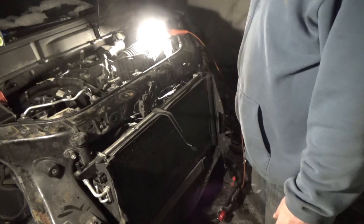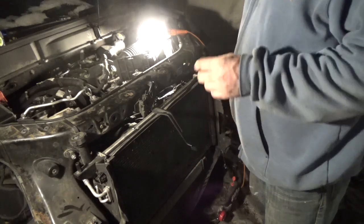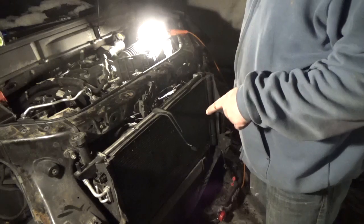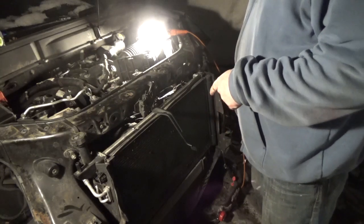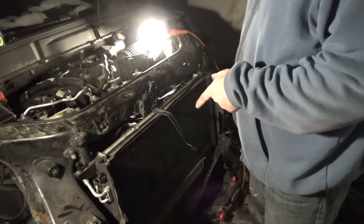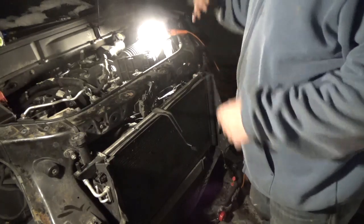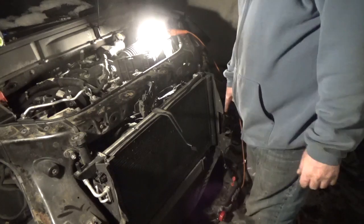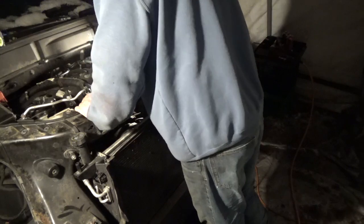So that's telling me it's blown out two ways. I think it's blown out the exhaust side the worst, and blown out the intake side where the water's dripping into the oil. So I think this motor's got two problems. One, a blown head gasket through the exhaust, and the other, a blown head gasket through the intake side. That's why it's got milk and water in the oil. That's nasty. So yeah, there was only about half a cup of water that came out of this thing.